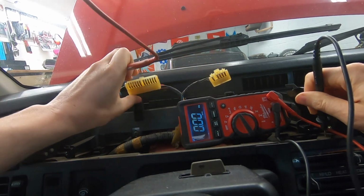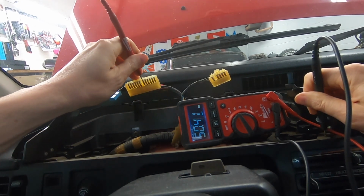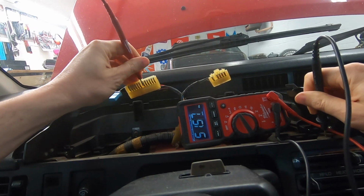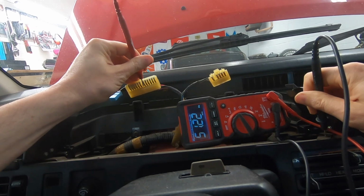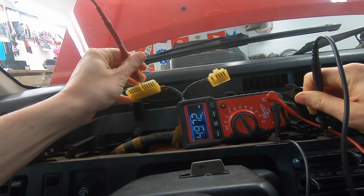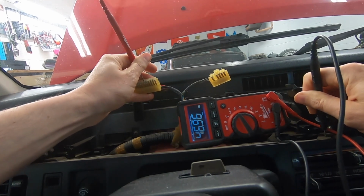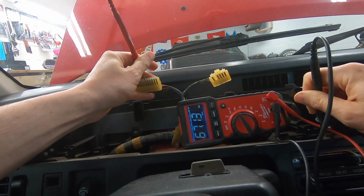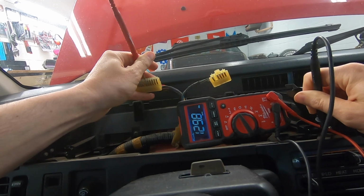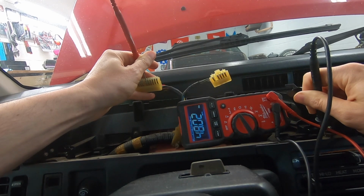Okay, so maybe there's a blue wire on here. Looks like this one right here. Oh, getting some hertz here, some frequency. All right, so looks like it's running around between, it's hard to tell, that the tachometer in the cluster will obviously change this, but what I'm going to look for is if I stab the throttle, I want to see this number go up. Oh yeah, alright, so that's the tach signal, so the signal is getting to the cluster fine, so something is definitely wrong with the cluster.